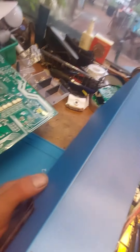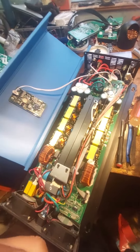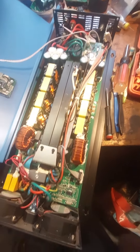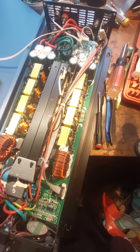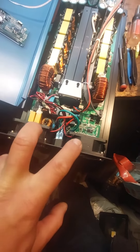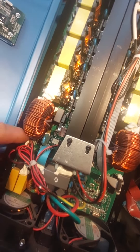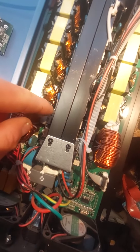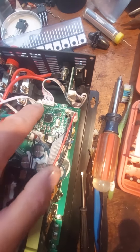This one is actually working right now, and because it's working I could diagnose what caused the fans to run permanently. Some people said it should be the relay for the fan, but there are no relays. There are three fans — one here and another two here — connected here. The trace goes on the other side of the board, under the heat sink, going to this board.